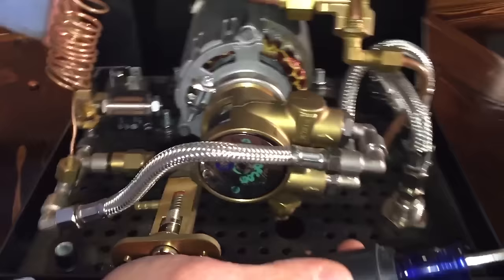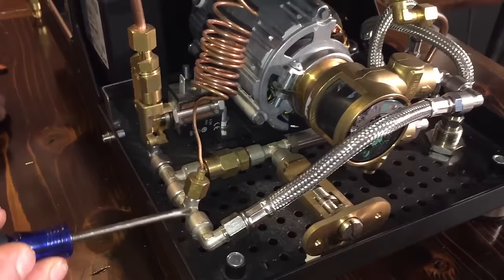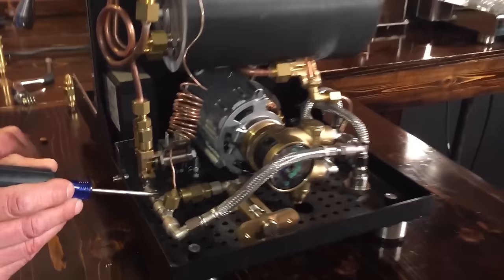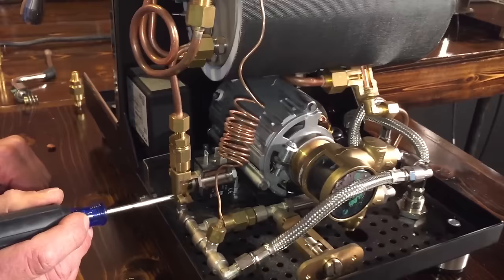The braided stainless steel line is actually a great feature to have. There's no Teflon tube in here — this is very durable, very good quality. Water comes through here to this T. This goes up to your brew pressure gauge, and then over to another T where water picks one of two paths: one goes towards the brewing system, one towards filling the boiler with water for the boiler fill. We'll go this way first — goes through your solenoid valve.